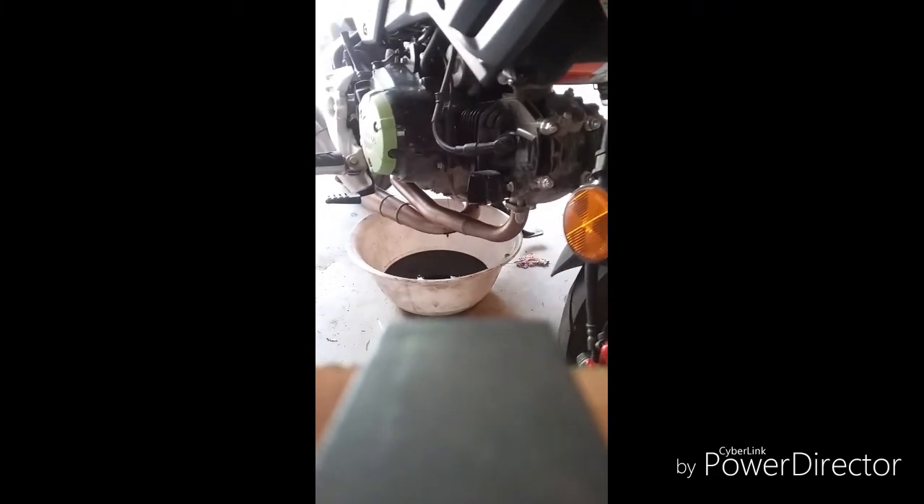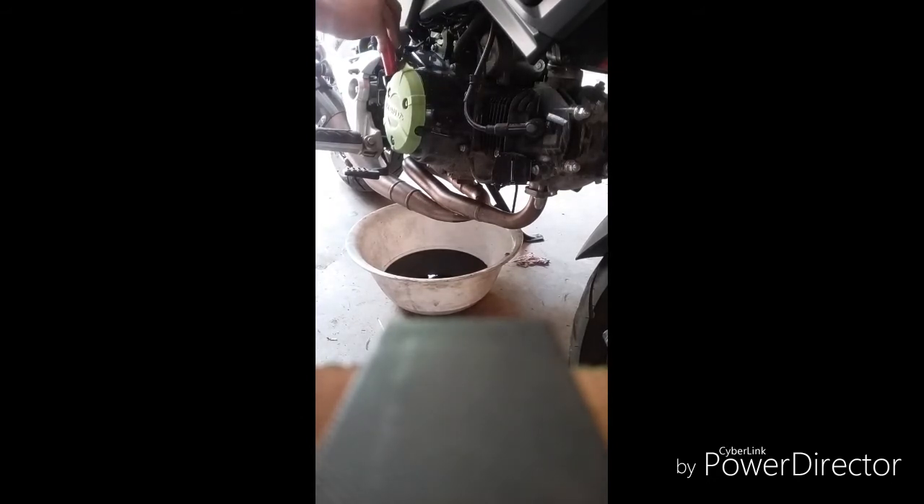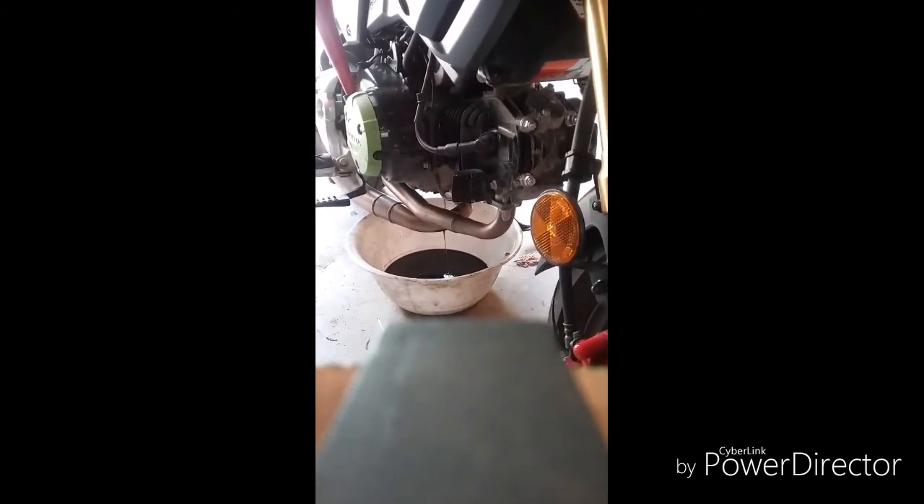It's getting drained. This drum holds just a little bit under a quart. What you do is — take the oil and don't put the bolt back in yet. Take the oil and pour just a little bit. The reason why I'm doing that is — you spin the bike back up and now it's draining all the excess black oil that was in there, and it's clean.